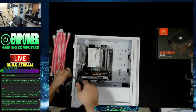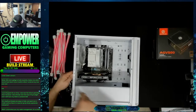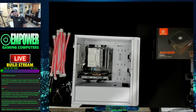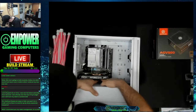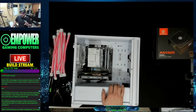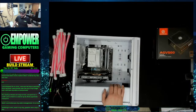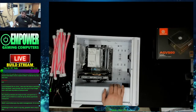Definitely the 1660. The 6400 just, they make it look like a badass card, but it is not. It's like a laptop GPU made for video editing. Not a good card. You will not be happy with that card. So definitely go with the 1660 over that. And if you can, look at the RX 6600s, because they're similar in price to the GTX 1660 right now. And the RX 6600 is going to run circles around the GTX 1660. So if you can make an RX 6600 happen, you're in good shape.